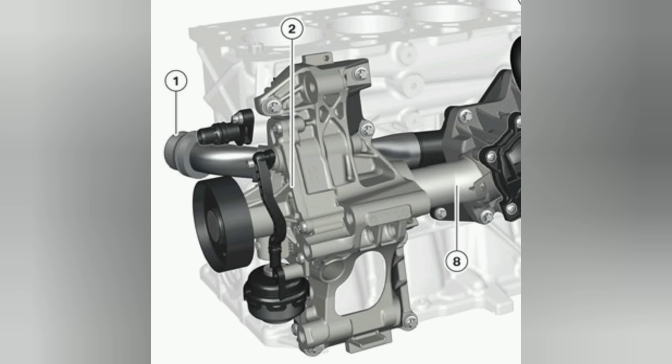With that, we've got three different water pumps. You've got an electric water pump for your low-temp circuit — that's the one that manages coolant flow through your intercooler and AC condenser. You also have a mechanical water pump for the high-temp circuit. This was a big switch from the past: we had an electric primary water pump, but now on the B58 engines we have a mechanical primary water pump that just runs off the serpentine belt. In the past, the electric pump could run after the engine was turned off to cool your turbo.